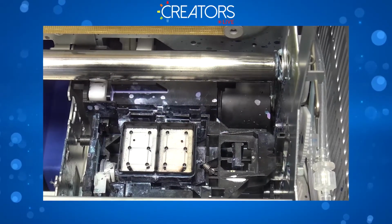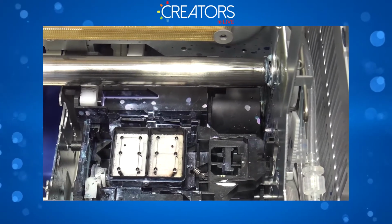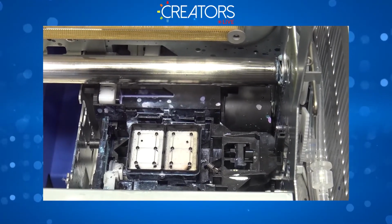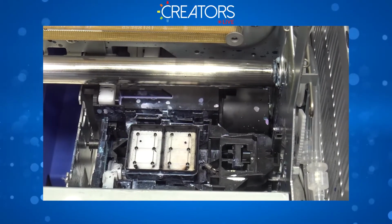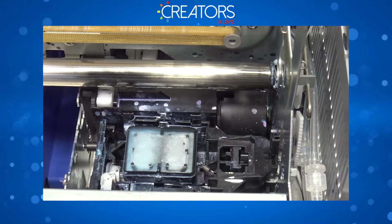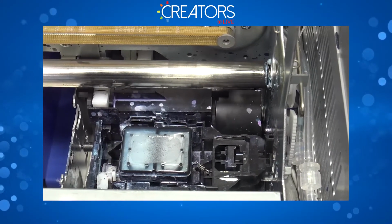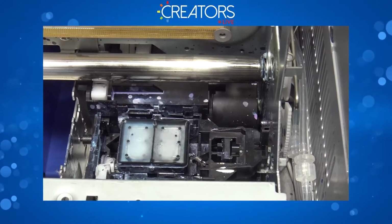Now you might be wondering why Morgan is pressing power down to flush that instead of using the plunger. The reason is that when we use the power down function to flush the capping station, the pump goes into automatic mode, meaning the manual mode doesn't work. You could plunge this 1,000 times and it will not flush this capping station, because of the power down function. So once you use that function, make sure